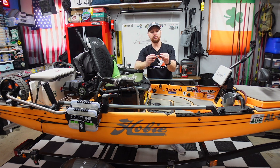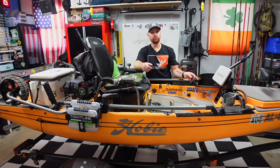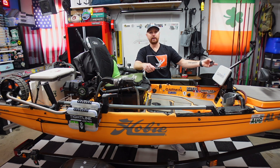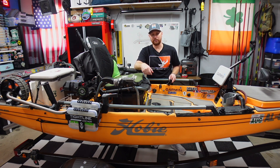I also wanted to add a voltage meter, so I'll be able to flip the switch on and look at the front of my hull and tell how much battery juice I've got left in the Dakota Lithium under the seat. It'll help me out if I start using too much battery, since this is going to go to the same battery that I run my Garmin on. With that Dakota Lithium 24 amp hour, I'm never going to have to worry about it running out.